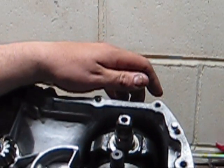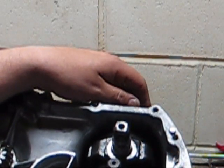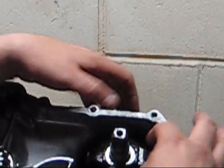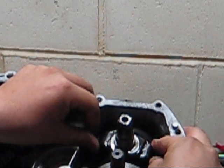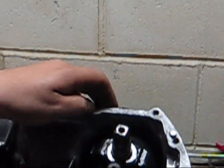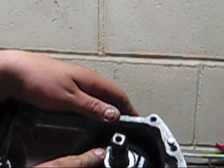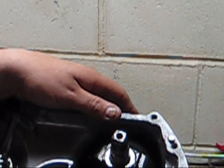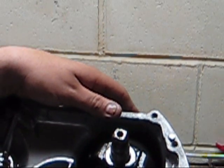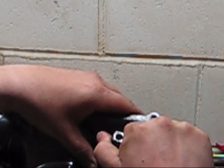Put it aside. So here's your swash plate, and when you go forward or reverse, it basically tilts this way, which is forward on this one, or the opposite way, which is reverse. So your pump and your centerpiece, which just directs the flow through the motor and the pump, aren't actually connected and can be removed separately.